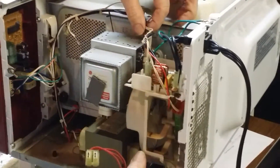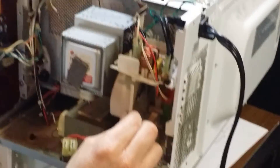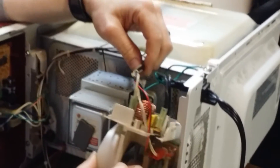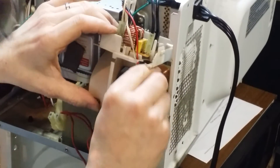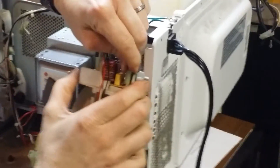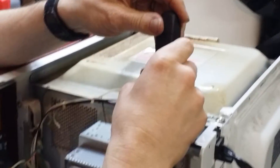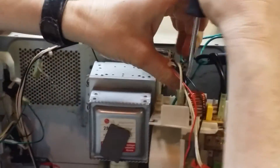The next thing I'll need to do to get this all the way out of my way is unplug the wiring harness. In the case of this particular model, unplug the fan motor, then unplug the power conditioning board — or remove the power conditioning board and leave it in place, either one. The power conditioning board is usually just held in with one or two small screws.